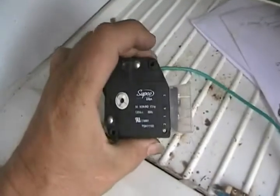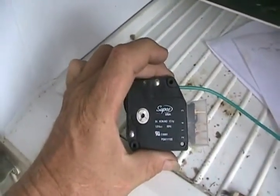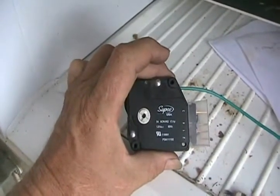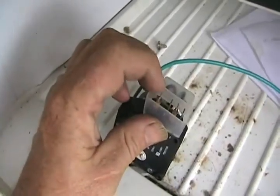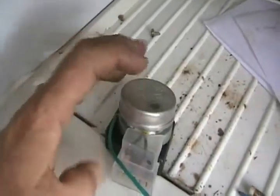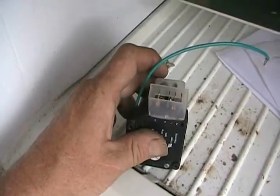If you do see a big blue spark, that means the timer's not functioning — it's probably just not working some days, or completely not turning around ever. So just replace the timer. It just plugs in; it's that simple. You will also see a tiny blue spark, and that's happening because it's energizing the little motor, but that's just a minor blue spark — don't pay attention to that one.